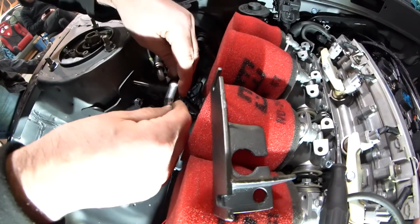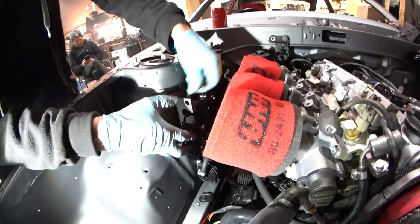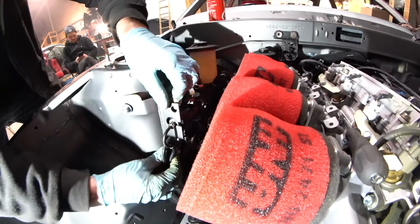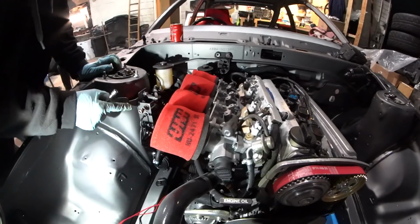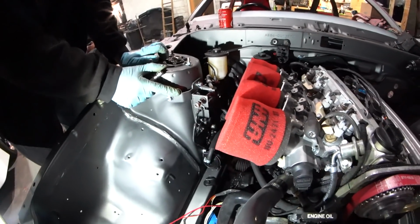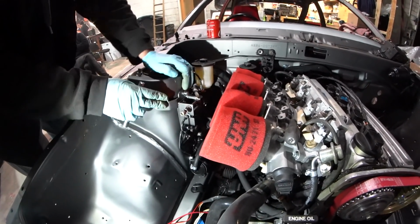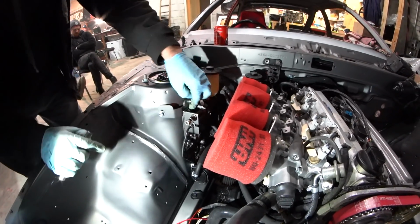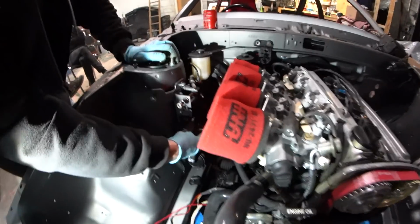New pieces of joy. It's nice that it still works, even though it was modified for the supercharger. Oh, nice, now it kind of hides the scratch. So this is mounted to the strut top. This obviously can float and is adjustable. You have to lock this down, tighten this in, and then lock it down with these two little 6mm bolts to finish it off. So it's just to get everything in a happy zone.